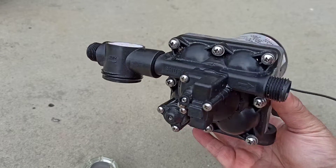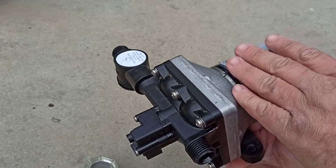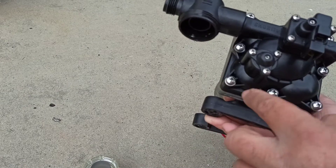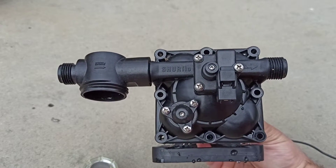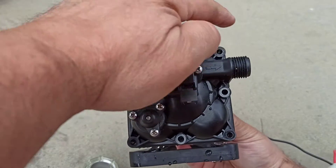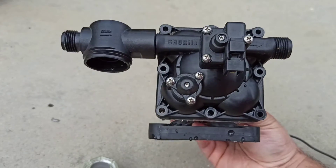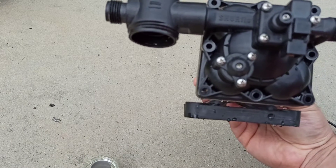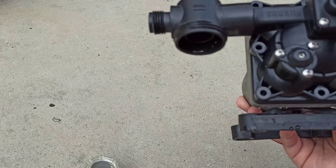The next step is to remove the pumping part of the pump away from the motor — this half is the motor. We're going to remove all of the big screws along the edge. The screws are now removed. When reassembling, a lot of people recommend doing opposite sides, hand tightening first, then bearing down with the screwdriver, to ensure an even snug fit in all directions.